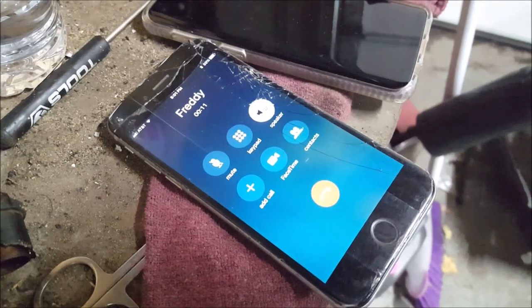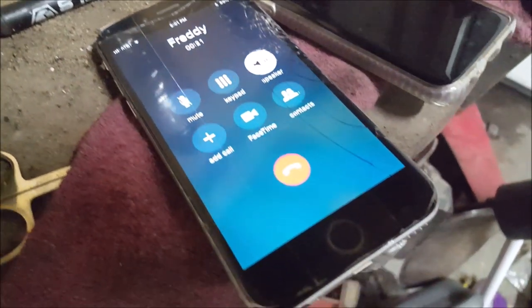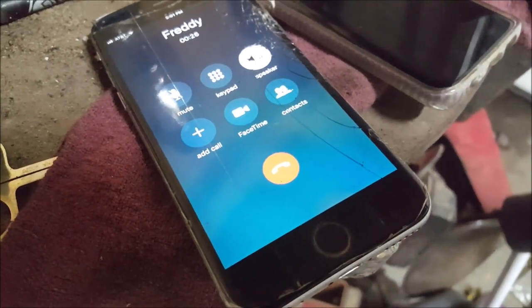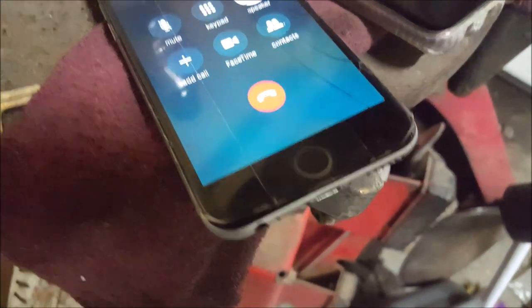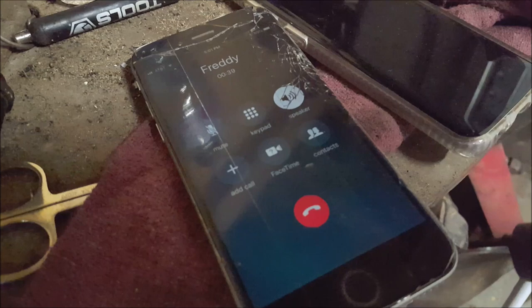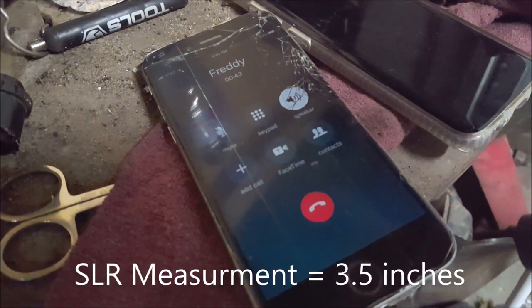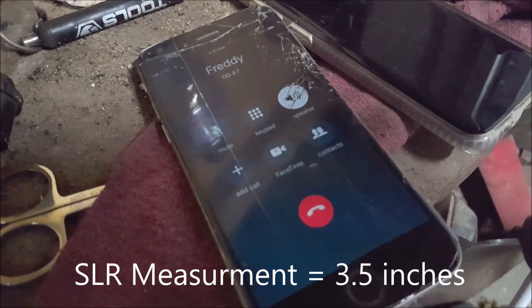How much did we take off — was it 14 millimeters? I don't remember. And then also I think you kind of offset the mounting point a little bit — was that towards the inside of the car? Yeah. Does Frank have an SLR? Yeah, but he's not here right now. Find his car and measure from the ball joints — his pivot pickup. Best option.